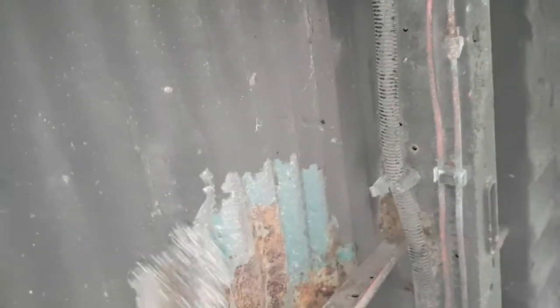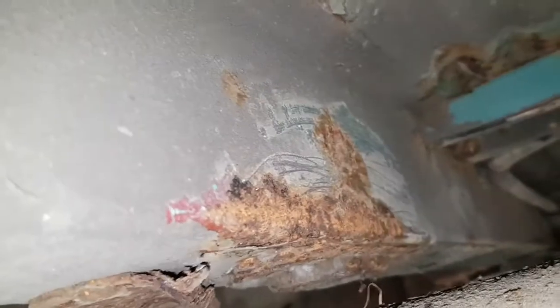You can see underneath I've been scraping back - it's a little bit corroded here and there. I've been using a pry bar. Just a few little holes there which I don't think is any big deal, but I shall scrape back what I can with the pry bar. There is some sort of coating on there already but a lot of it came off. I'm going over it with the pry bar and a wire brush all over the vehicle - any bits like that near the exhaust. I've been scraping back, going over with the wire brush, and I'll put the bitumen paint over.